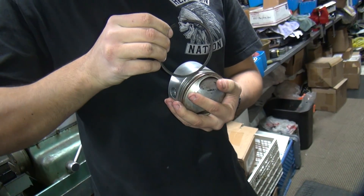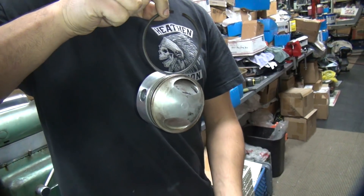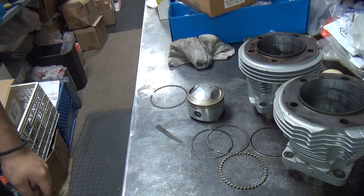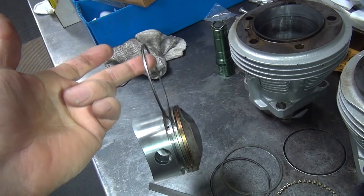How's your ring gap? Tight. That's what happens when you have a 103 pan - it detonates like crazy, collapses the piston down and makes the ring tight. Yeah, that's race stuff. So it's a little snug on the exhaust side.